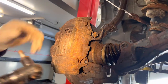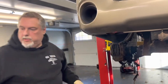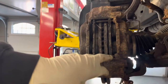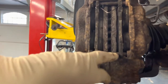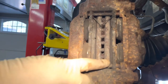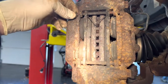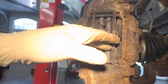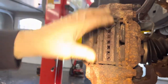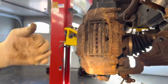If you're doing this job at home, you have to keep in mind you have a four-piston caliper here, and a lot of times these pistons seize up. Look at how these bolts have rusted and swollen - the pads won't move and the pistons always seize up on these. If you can't get the pins out, you have to drive them out and find out if your pistons are frozen. This guy bought new rotors and calipers, so that's saving us time.